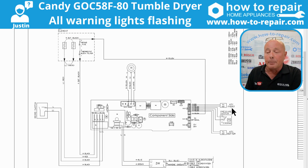There appears to be a front NTC sensor at the top of the machine and an NTC sensor at the bottom of the machine according to this wiring diagram. The manufacturer does not give me the ohms resistance values needed to determine if the NTC sensor is correct. There is another video in the description below showing how NTC sensors work and how to measure them using ohms law — they will have a resistance of, say, 5,000 ohms at 25 degrees. You put the NTC sensor in a controlled environment of 25 degrees, measure the resistance, then increase the temperature to 30 degrees and the resistance should drop. This tells the circuit board what is happening.